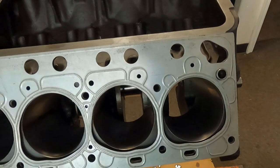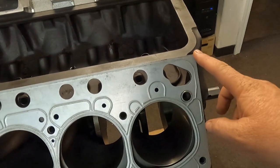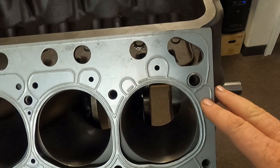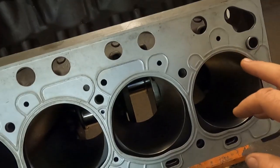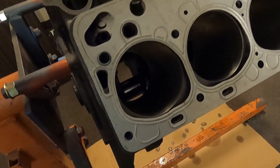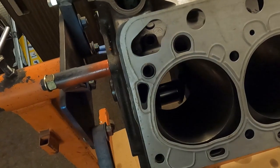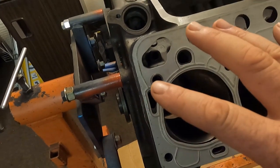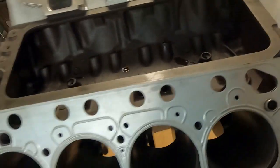Moving on to the head gasket — this is an old OEM head gasket. A lot of the Y block head gaskets had the square corner and they go to the front. When you look at the head gasket in the front, you'll see it's blocked off here, small hole here, and then you've got some consistent oval holes on the bottom. So blocked off, small, small — these are oil holes, water hole, small. Once we get to the back, you'll see this is where the gasket really opens up, and this is what allows the main bulk of the water flow to travel all the way down the block, then rise into the cylinder head through these main passages, and travel down to the front to exit at one of the front water holes in the head.